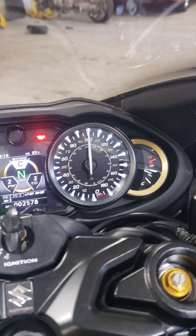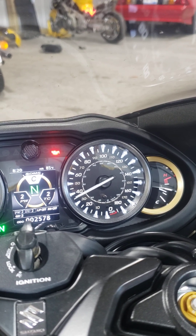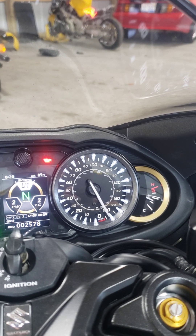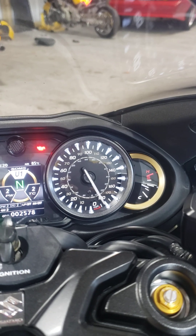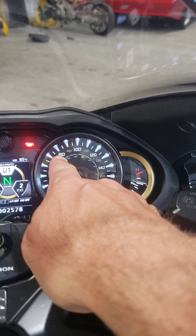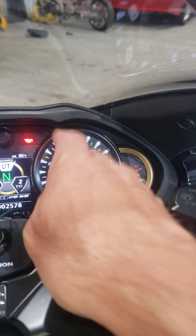Go to C mode and that's now throttle. Go wide open throttle — I'm at 100%. So if I was trying to do some tuning I could hold a steady state throttle and see where I'm at. U1 mode is lambda. A lambda of 1 is stoic air-fuel, 14.7 on gasoline, and that would read as 100. Lambda of 0.8 is what you'd want under big power on a turbo; north of lambda 1 would be scary under power.